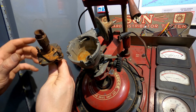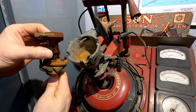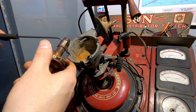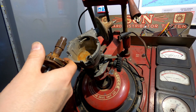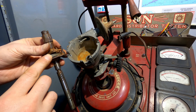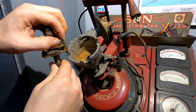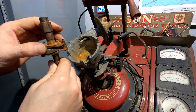The shaft is going to twist the other way. That does two things: one, it's changing how far forward or not forward your rotor arm is, but the second and more important thing is you've got the lobes that open and close your points — those are going to be opening and closing sooner or after a little bit more time. This is the mechanical advance. When you speed up the engine, the faster it's spinning, the more these weights are going to be thrown out, overcoming the springs, spinning out farther, causing it to advance more and more as the RPMs increase.